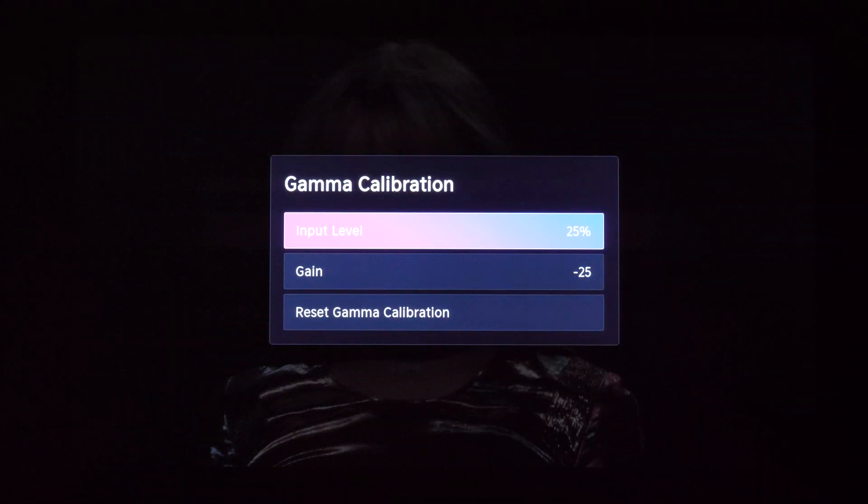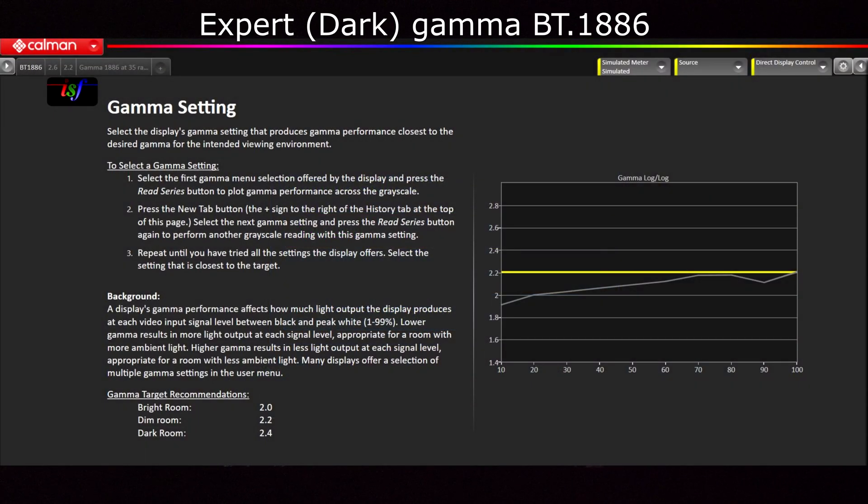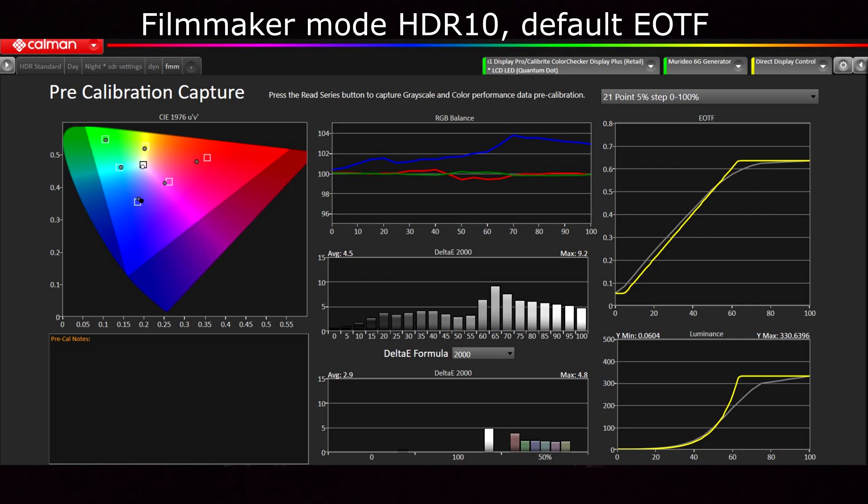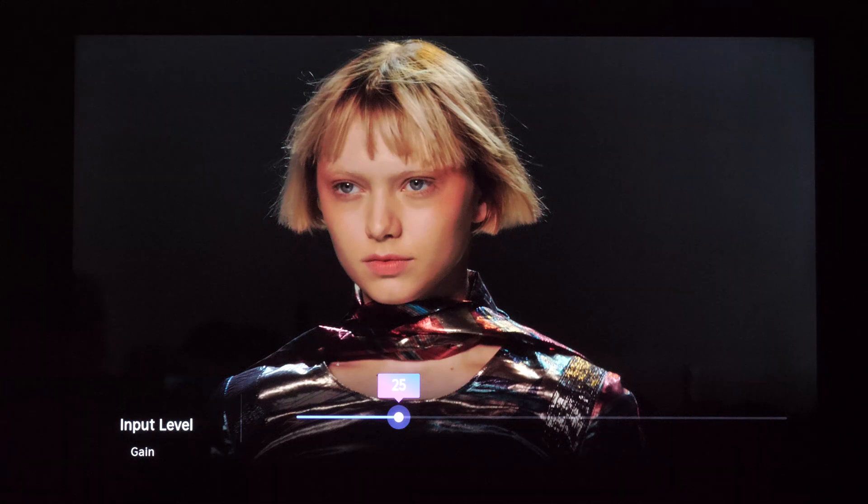Next, I did gamma calibration. On this TV in SDR and HDR, gamma is highly inaccurate — I haven't seen such inaccurate gamma for many years. So I did extreme adjustments. Default is zero; for this level I went to minus 25 to come as close to the reference point as I could, but that still wasn't enough. Also, adjusting input level 25 is actually affecting level 35 of the picture, so everything is plus 10 affecting the image — something I've seen on other TV brands in the past, and now also on this Hisense model. For some values in the lower part, I did these big changes.